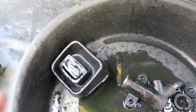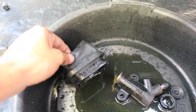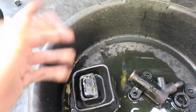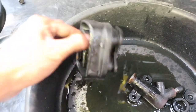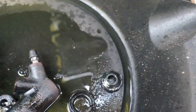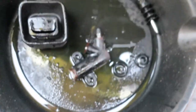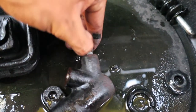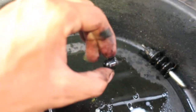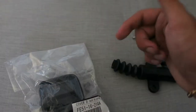This is everything we just pulled off. This is the old fork boot. Mine wasn't fitted on right — I learned that these are made with all natural rubber, and with age, time, and brake fluid running through them they actually expand. Once removed off the mounts they do not conform back, so you actually have to replace it. You can see I tried to make it fit by squishing it. This is the old cylinder — you can see how the cylinder boot completely deteriorated over time. We're not salvaging anything. The only thing I'm keeping is the little cap because they're good to have around. These are OEM parts from Mazda, but I got them on eBay — links will be in the description.